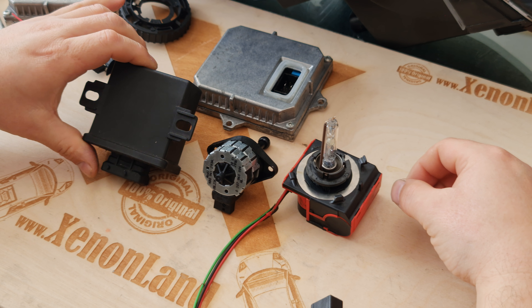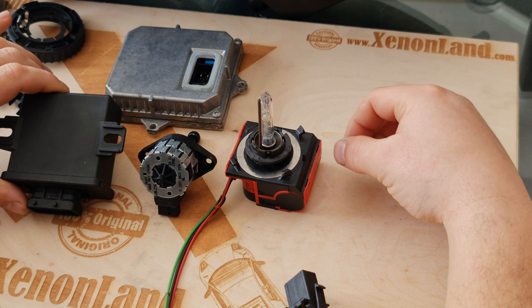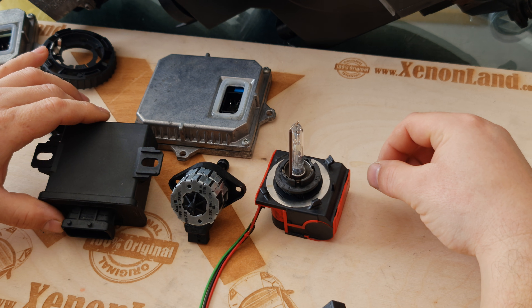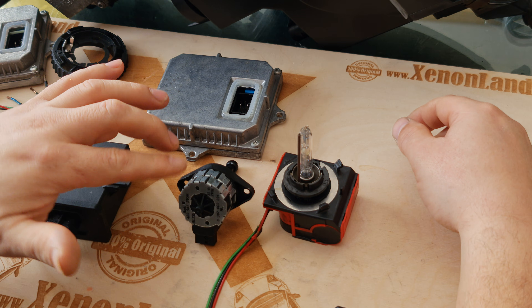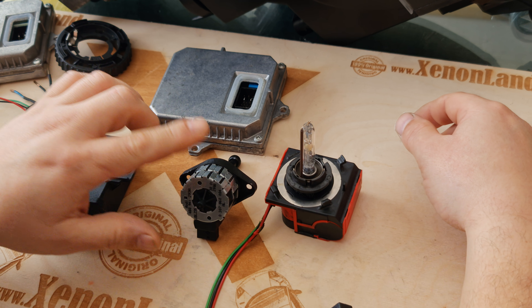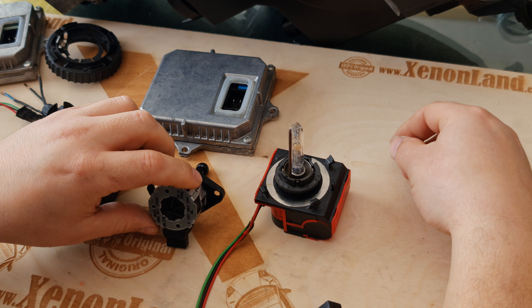which gives information about the height of your headlight beams. According to that bumper sensor, the lighting module sends instructions to the ballast unit, and in turn the ballast unit tells the leveling motor at which height your light beam should be.